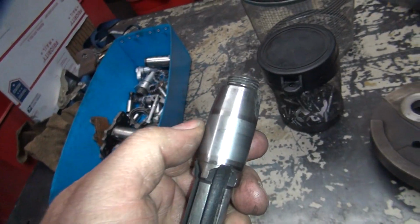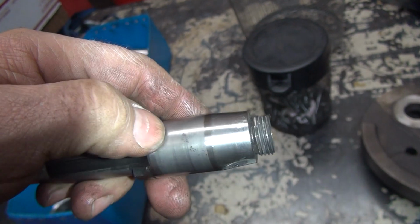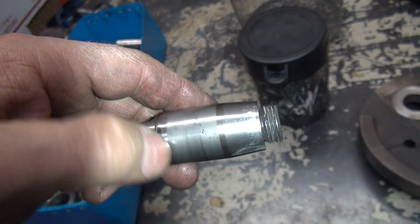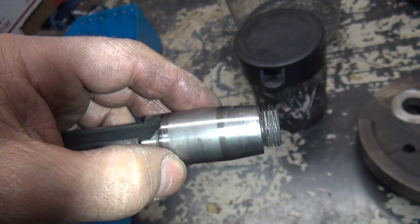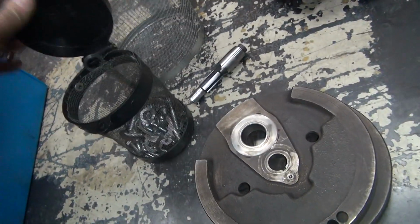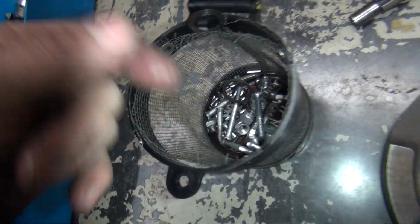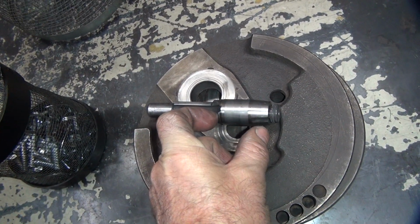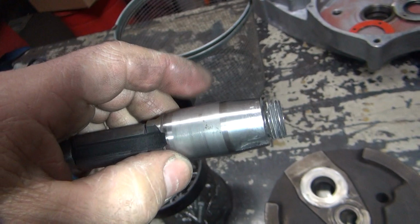The pinion shaft right here has heavy acid etching also. Matches everything else. And the worst spot is this first inner bearing area, because that's where it really rubs hard. You can see how it rubs more hard on the outside and on the two outside edges. In the middle here, it's not much. Doesn't wear as much. Just trying not to do that. The rollers are in here. I have to get one later. Yeah, they're real long rollers, and they push side to side. They don't roll evenly. I think it's more the crank flipping around than anything, but anyway.